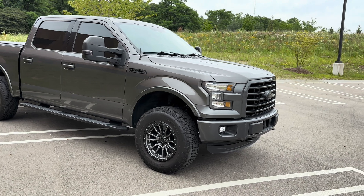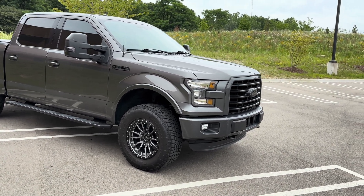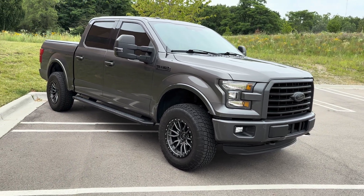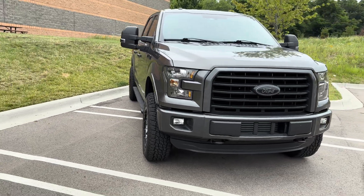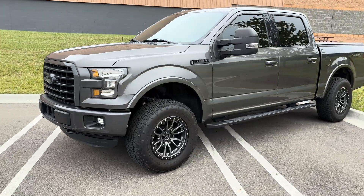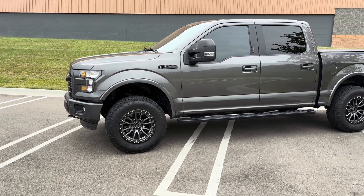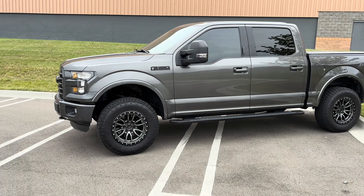After that, I did some Ford GT cold spark plugs. Those will ignite your fuel at a different temperature range and are a lot safer to run when you're making more power than stock. The spark plugs run about $75 and will definitely help with less knock, so you'll run a lot safer with those.